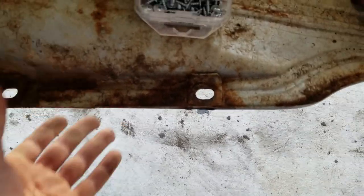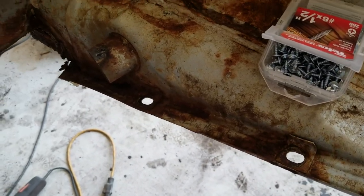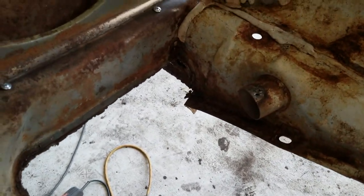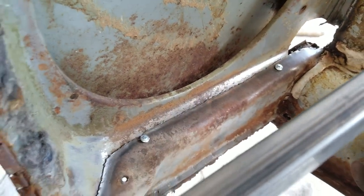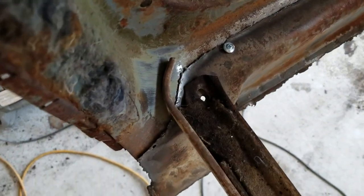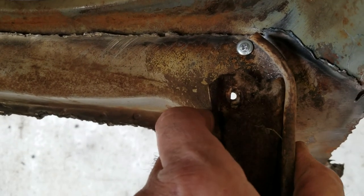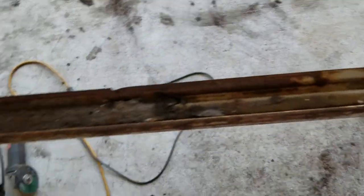There's always a little metal bending, so you're gonna have a little bit of wiggle room. The trick is just having the wiggle room where you can. On inner panels right here you can have a little bit of wiggle room, but on the outer panel where you're gonna be looking at it, you can't have any wiggle room. Look at that - the seat bar lines up right in the middle, not even any bolts in it. This is my first look at it, I just dropped it down just now.